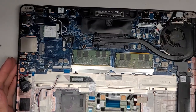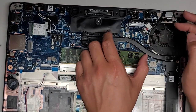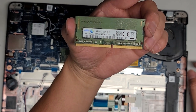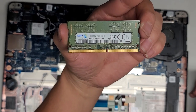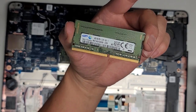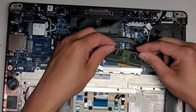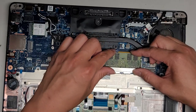If you're wondering about the RAM — pull these two tabs to the side. Here's the RAM: 4GB PC4-2133P. You can put any size stick of RAM as long as it's PC4-2133P and you should be okay. So if you want, you can get two 16GB sticks, but make sure it's 2133P.